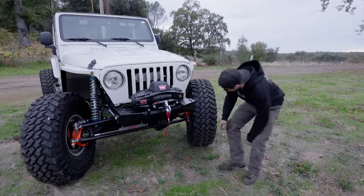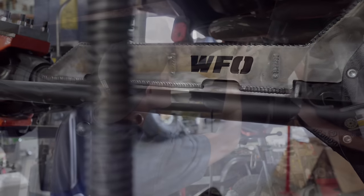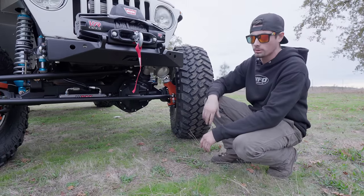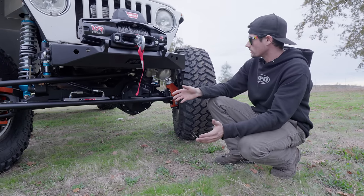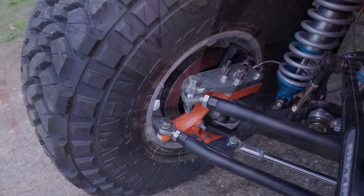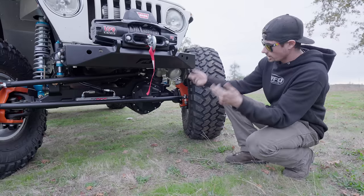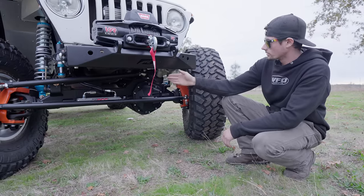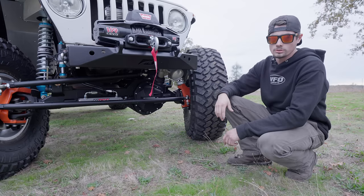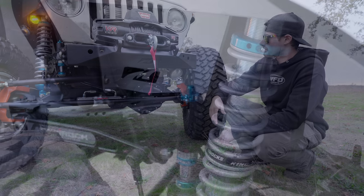If you come down here in the front on this axle, we have our low-profile truss on there, and that just gives us an easy place to mount the upper link, bump pads, sway bar mounts, track bar bracket, everything you need for one of these 3-links. We got an anti-rock sway bar on the front, kind of keeps everything stable on the road. Reed knuckles for the crossover steering to move that drag link up so you can roll the tie rod to the top. Got a PSC ram for that hydro assist hooked to the PSC box. Really just makes everything easier to drive on the road. When you're in the rocks, that ram helps you out in a tight bind.